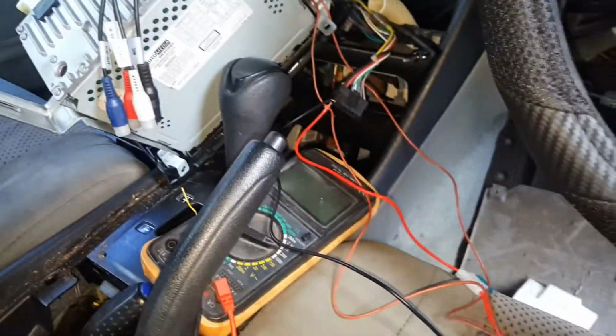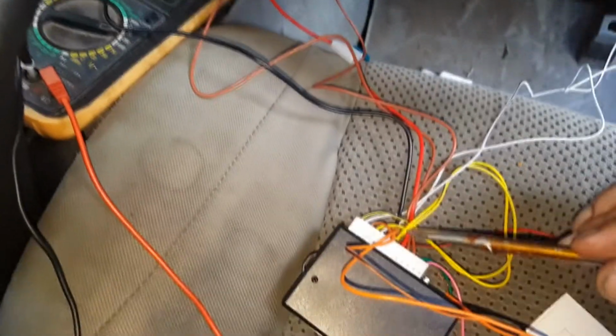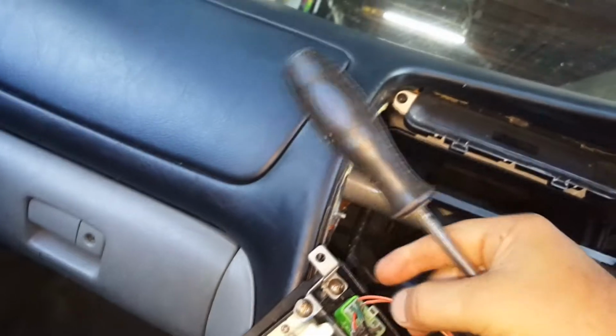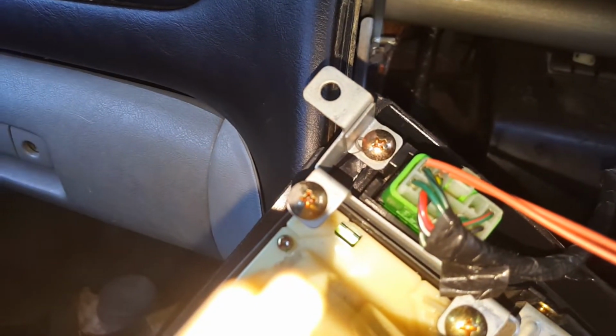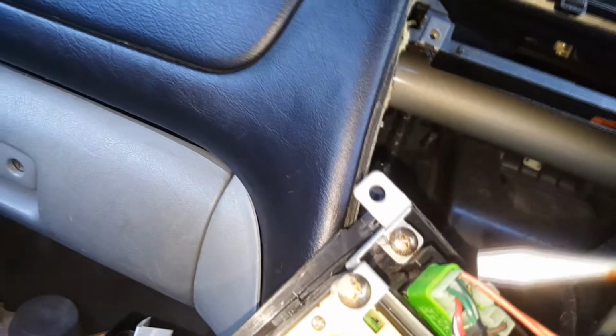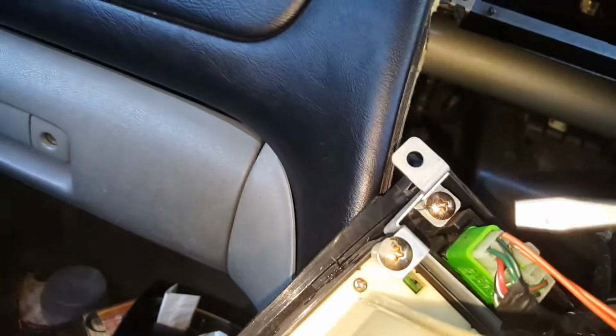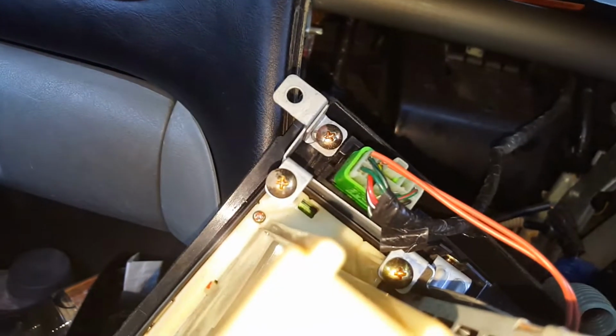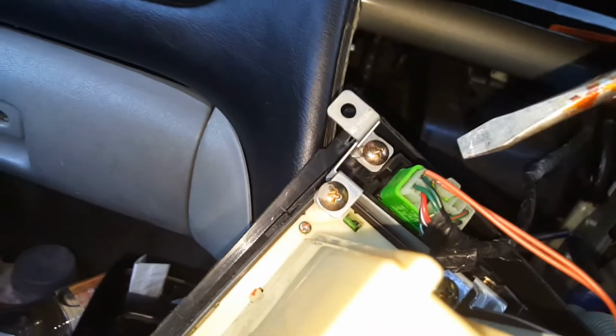You've got two brown wires that come here, and from the central locking here, from the keyless entry here up, and then to behind the hazards switch, these two here, as you can see they're just poked in at the moment. Those two top ones there, this one here is to the two indicators at the back, the top one is to the two indicators at the front. And there's two brown wires that come from the keyless entry box that go to there. So when you activate the locking or unlocking, your lights will flash.